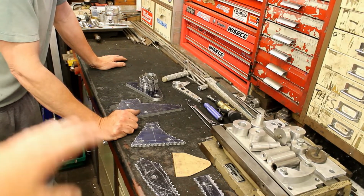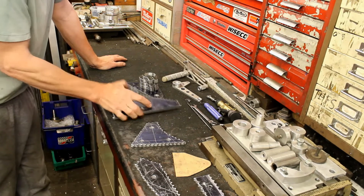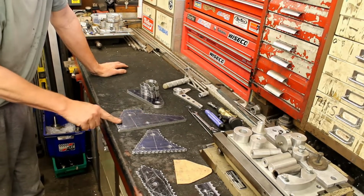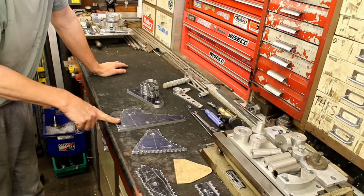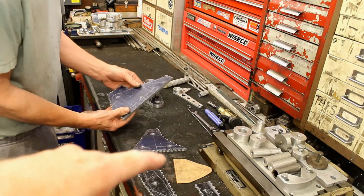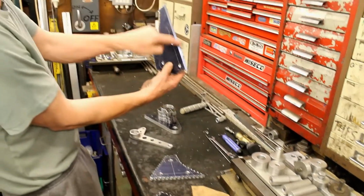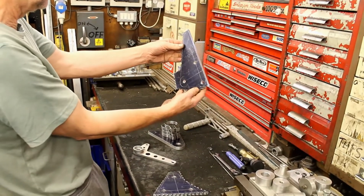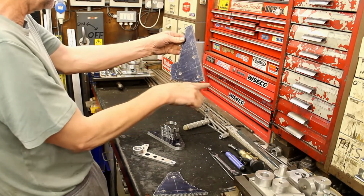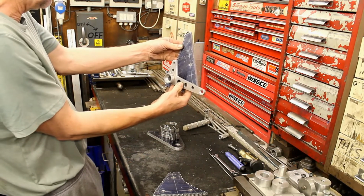So we've got here 2 brackets, just chain drilled out for now. We drill the holes, or you drill the holes, as you can see. And we've got a bit of a question mark for the brake side, because we need to attach the Brembo master cylinder. So if you grab the master cylinder there, Jeff. Well, basically, like you say, that'll suit the angle of the frame, and I'm guessing it's probably going to be maybe even flat when it's on, like parallel. I'm not sure. But I should imagine the lever may go down a bit.